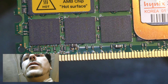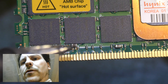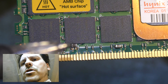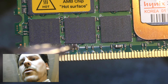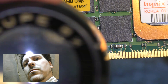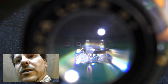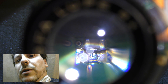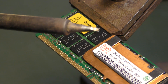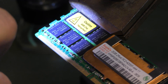I've moved down into the basement and here you can just see it — that capacitor right there is supposed to be down here, but it has moved up there and it might be short-circuiting some of these little tabs. So I will try and do the soldering — use the soldering iron to remove it, put some solder on there, and put it back in. It's going to be a tiny job. I have a little magnifying glass here. It looks like it has flipped over. Maybe I should just try and flip it back and re-solder it.